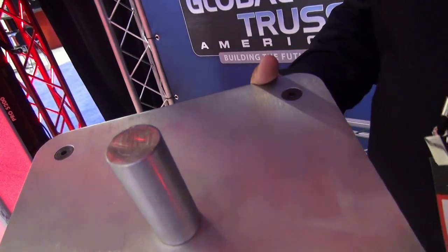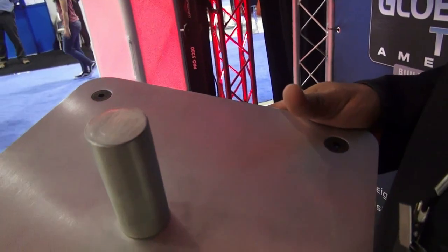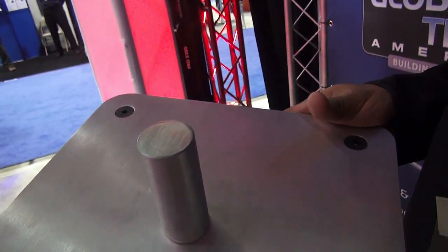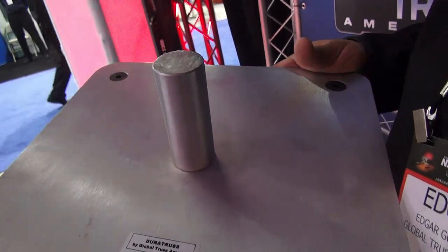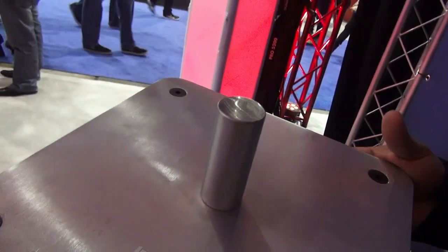So, totem with speakers on top. The 1-3/8" is the smaller hole, not the bigger hole, not the 1-1/2". If you had a 1-1/2", technically you could put a spacer in there and still mount your 1-1/2". And it eliminates having to strap down your speaker for a more clean setup.